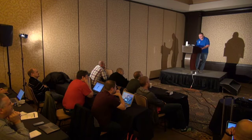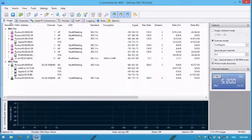Okay, now it's working. On the nodes tab you can see it instantly fills in all the nodes. Think of it as a super robust scanner - there are a lot of really good scanning tools in the market, but this has it built in and gives you a huge amount of detailed information. One important thing about the signal column: it's not necessarily intuitive - it shows minimum, average, and maximum left to right. Most times you're looking at the middle one.